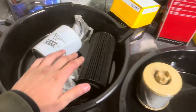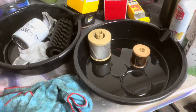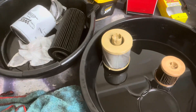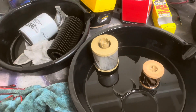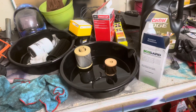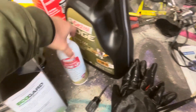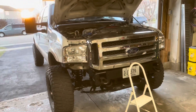Here are the old filters for everything — coolant, oil. This is the fuel filter on the frame rail and the one on top of the motor. I got diesel on my face doing that one, so definitely relieve the pressure on the fuel system before you do those. You can use the little water separator Allen key to relieve the pressure off the fuel system. I also put in new oil, and I'm going to go get a full tank of diesel and then put the Gumout tune-up stuff in there.